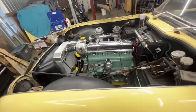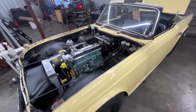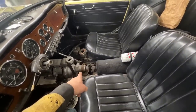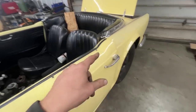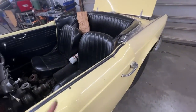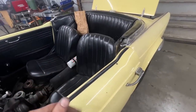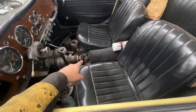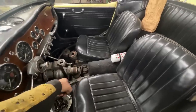So I'm gonna abandon the engine bay for a while, because before we start the engine, I want to hook up the drive shaft, but to hook up the drive shaft, I first want to take it out, take care of the differential. Look how I'm pointing at the differential. It's somewhere under there. So I need to change the seal on the front of the differential and the gasket. So we're gonna service the differential. Then we're gonna put the drive shaft back. We're gonna check the U-joints while it's out. And once it's in, we're gonna hook it up to the transmission.